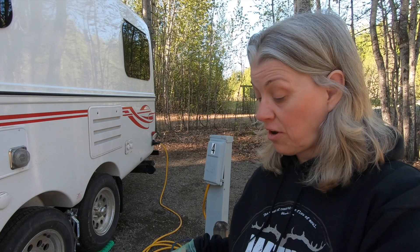One of the things you need to do at an RV park is dump your tanks, and we're gonna do that right now. We did not hook up our sewer hose when we got here because we usually do that when we're leaving. You can hook it up, but you don't want to pull your valves until you're ready to leave. In my opinion it's better to leave them closed the whole time you're here until you have your tanks full — that volume is gonna push everything out a lot more efficiently. You want to do your black first, then your gray.